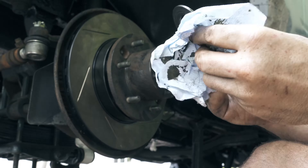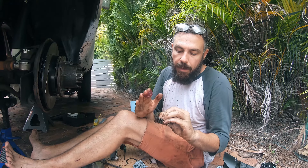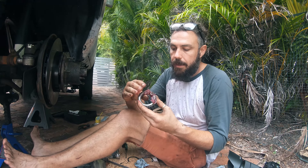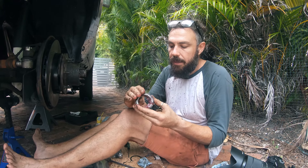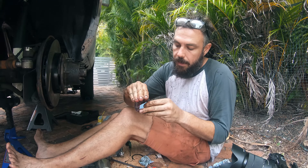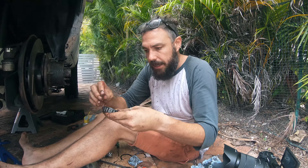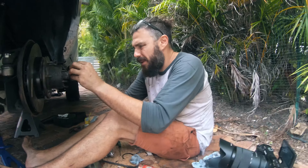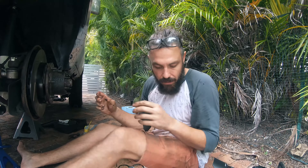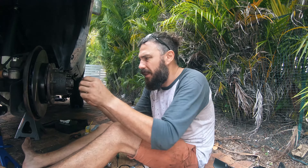Have some shop towels or a rag handy, and take this opportunity to really hammer some grease into your bearings. You look at the little rim here and you really want to try and force grease down into it — when bearings are new you can actually get grease to come out the other side, but because this is already kind of packed it's pretty hard to get it all the way through. Just do your best. This is a Valvoline high temperature grease. That's the first thing that goes back in, all the way up in there. Next thing is the locating washer — it's got a little notch on it and there's a notch on the thread that'll line up.